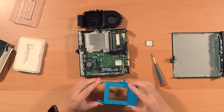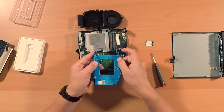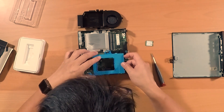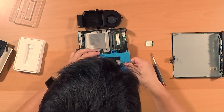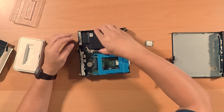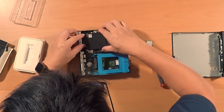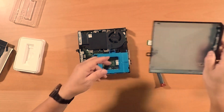You can also add another hard drive here — buy a SATA drive, put it in between here, and that's it. Now let's put everything back. Slide this in — perfect, it clicks. Put this back in, reattach the wire on the hook, and close it.